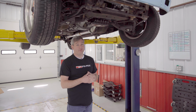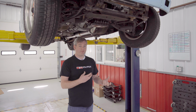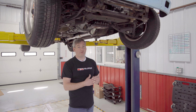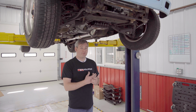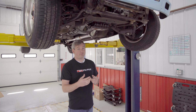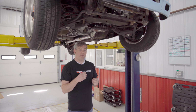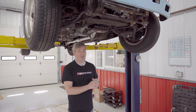But the other thing I'm going to do is modify the rear end, convert it from leaf springs to coilovers, and kind of create some type of a semi-three-link suspension setup. I'm still working with my good friend Alex, who is a wonderful suspension engineer, just way smarter than I am in that regard. So I reached out to get help from a friend, and that's where we're going with that. So I've stopped the exhaust at that point because I don't quite know where all the suspension arms are going to be just yet. So once we get the suspension more finalized, I'll finish the exhaust to get it up and over the axle and out the back of the car.